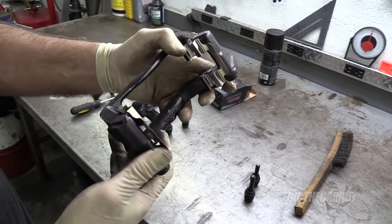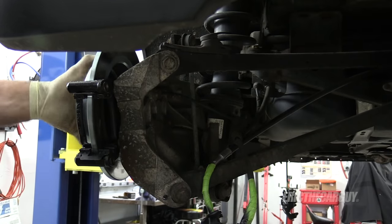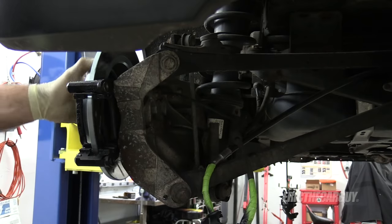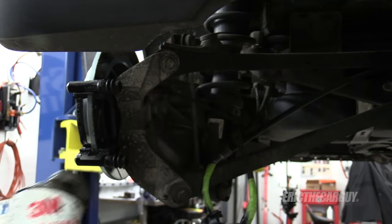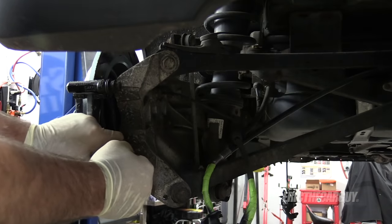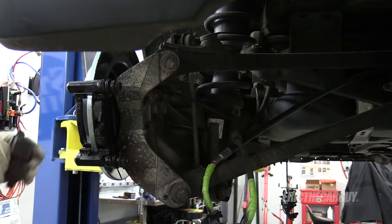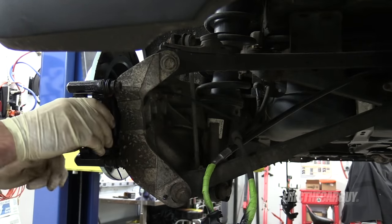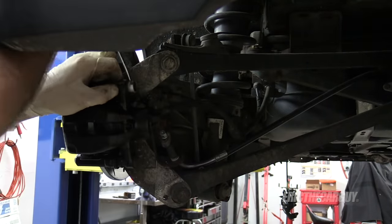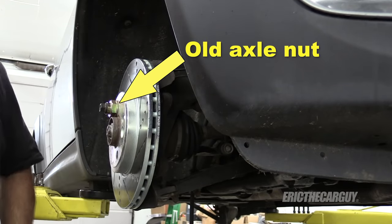The result? Gorgeous, aren't they? Here's a critical step, especially when you put new shims on: spin the rotor. Make sure you don't hear anything with no pads or anything on it. Sometimes this metal will stick out far enough to make contact with the rotor and cause a noise that will drive you insane. If you check it now, you don't have to worry. I take a little bit of silicone paste to put it on the slide pins. These pins are the same top and bottom from what I could see. I will link in the description videos I've done on brake pad replacement to help guide you through that. New shims can be a little challenging.